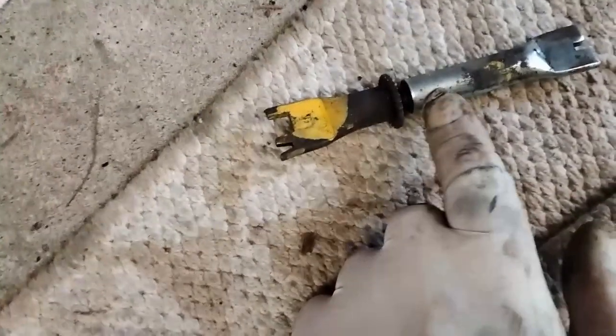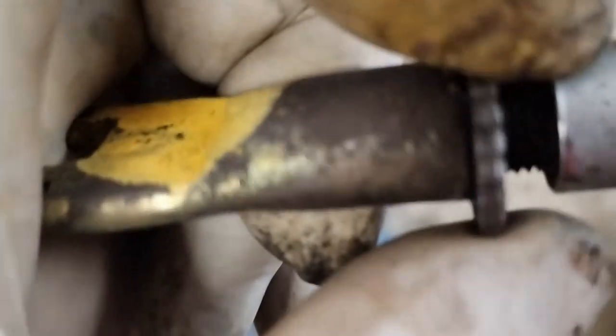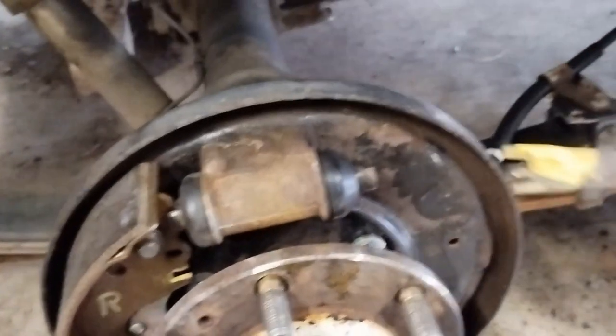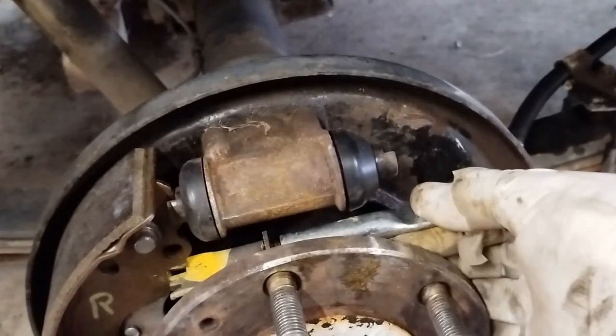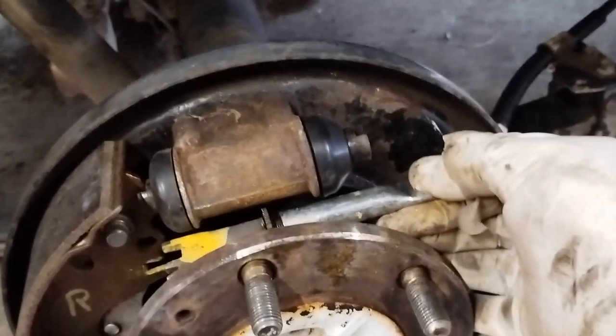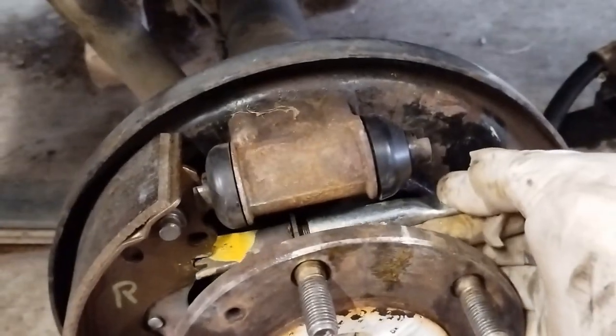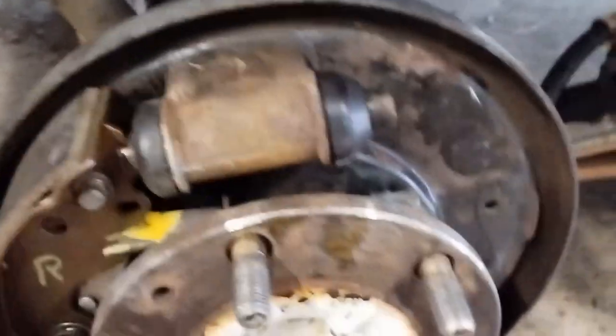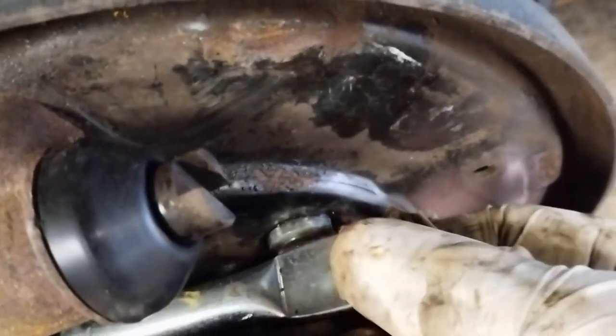This is the spacer here, and I've adjusted it in here just a little bit so that it's a little bit shorter, because that cam comes along and it turns this cog here, and it tightens up the shoes to the correct width. Okay, so here's the spacer, and we can see that you can put the spacer in place so that it goes on the shoe and the arm behind it for the handbrakes. That will sit there. Okay, it seems to sit on a small stud just there. So it'll sit on top of that.